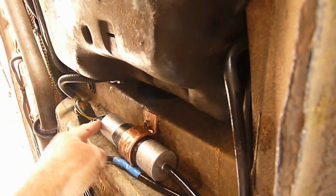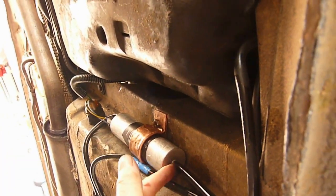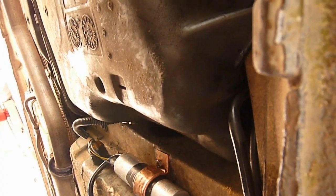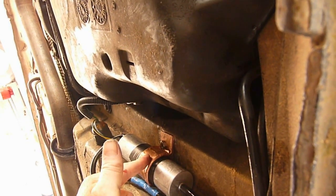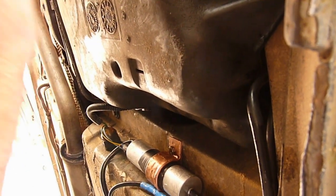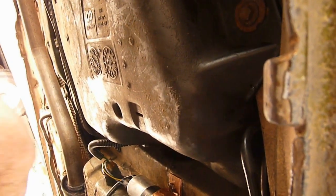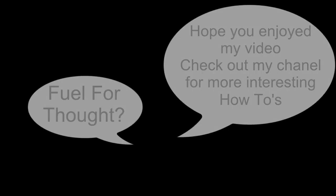The pump is priming itself. The most important thing with the pump is to make sure the pressure is the right bar — for the Picasso this is a three bar pump, but this pump is actually 3.5 bar. It's a little bit noisy because it's on the outside of the tank, but we'll lever it away from the body and put a bit of silicone down the front of the pump, and that will take a load of vibrations away. When changing the pump this way, you shouldn't spill a single drop of fuel — just disconnect and reconnect the pipes without having to enter the tank. When this pump packs up it'll cost 35 pounds to replace, whereas when the Picasso's in-tank pump packs up it costs 130 pounds plus the hassle of taking the tank out and emptying the fuel. This is the way to go.